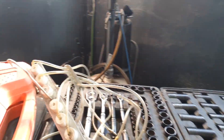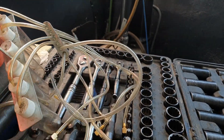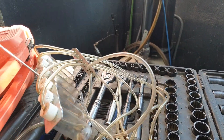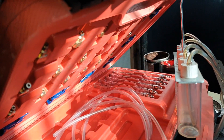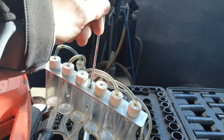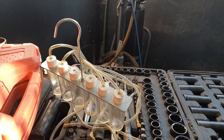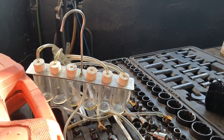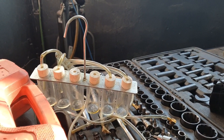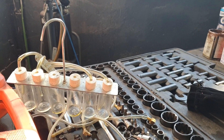What I'm going to use is a little leak-off set of bottles with the correct adapters on the end. There are quite a few different adapters in this kit. The next step I'll show you how to set it all up. We do a three-minute idle test and we're looking at approximately 25ml from each injector on the leak-off.